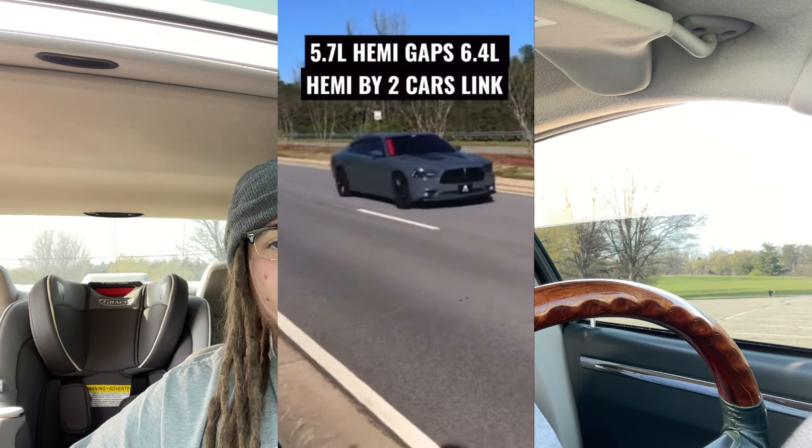I do want to mention that some people have done the 6.4 liter intake manifold with the active runner intakes and wired them up. They say it increases horsepower and torque just a little bit and improves the top end due to that active runner situation. Overall, you're going to keep up with the scat pack with these modifications. If done right, possibly put a car or two on them. You don't want to blow out your differential trying to race a scat pack, or be stuck in traffic heat soaked with a stock 203-degree thermostat when somebody pulls up for a fun run. Keep it running nice, keep it putting power out consistently, and have a lot of fun surprising people with this little 5.7.